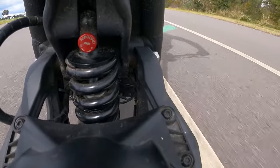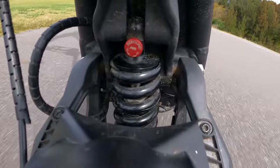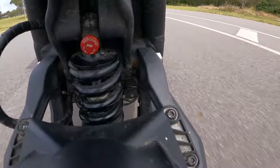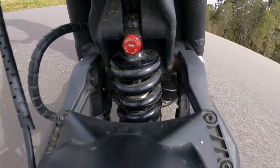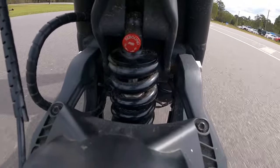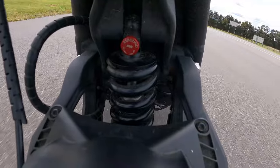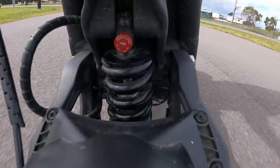Going into some sweeping bends now. There is a little bit of vibration coming from the front - that's because the wheels need to be balanced. I've got some weights coming and we'll see if we can get that sorted. There's a shake there - you can see it really needs to be adjusted properly. I need to have those wheels balanced - I've got five-gram weights on the way and I'll show you how to do that in the next video.